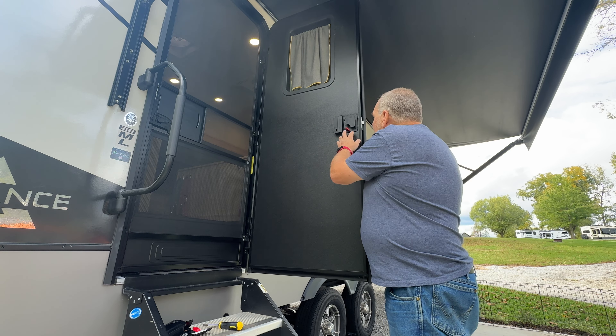I just heard a little jingle — it's an RV lock — so that means we have power. I do want to point out a useful tip: when we first bought our Lance, ours was sticking and sometimes just would not work. I called the company and they told me if you over-tighten the screws it almost binds up the mechanism. They had me back off just a little and we never had a problem again. So if yours isn't working quite right, check how tight your screws are. Wow, I like the looks of that on the outside!